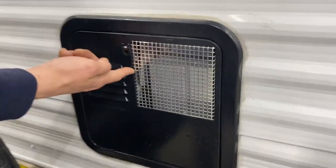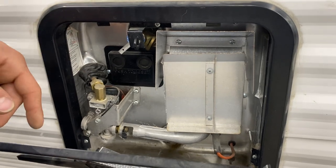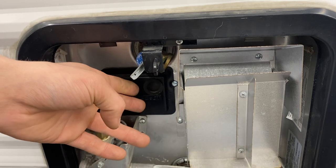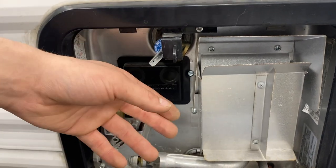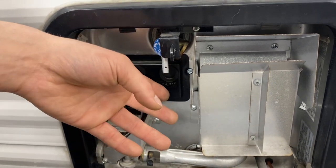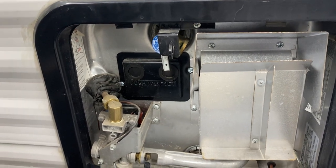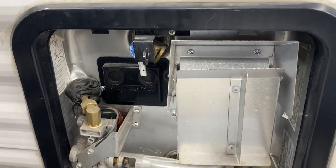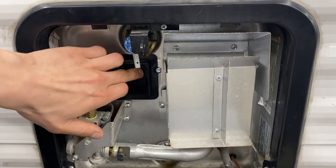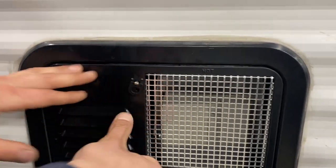At the very back we've got your hot water tank. Line up that one little keyway and it pops open. Before you ever turn it on with the interior control, hit that release valve. If the tank were full, you'd get a shot of water out of there — we currently have the unit winterized so it's empty. You want to make sure you get that shot of water out before turning it on; if there's no water in the tank it could burn things out. Once we get inside, I'll go over a reset procedure, and the button for that is just right here.